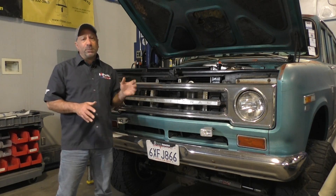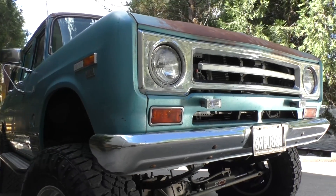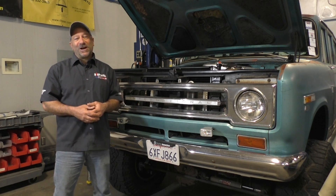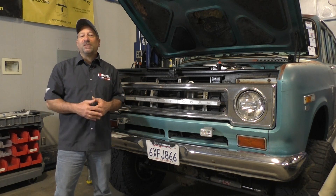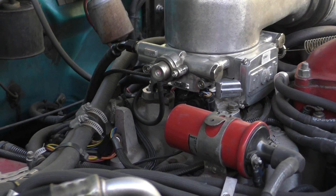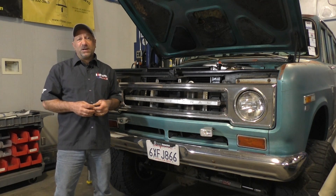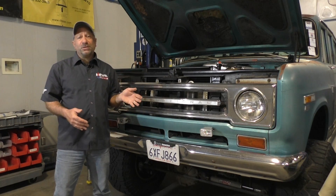You'll remember back on my last video when we had a full talk about Zeus — I mentioned that the Fitech had died a couple of times over the years. I must have jinxed myself because it wasn't long after that video that the fuel injection quit sending a signal to the fuel pump. What I don't like about the Fitech is it doesn't have an external relay as part of the fuel pump circuitry, so it puts a lot of load onto the ECM. It burned out a second time, so I decided to go Sniper.